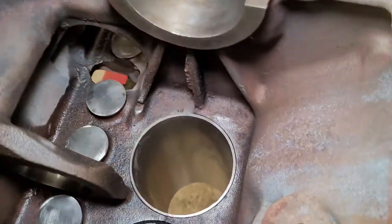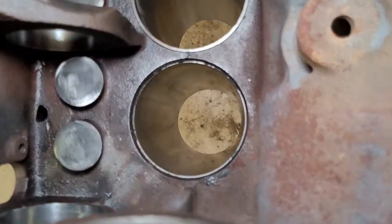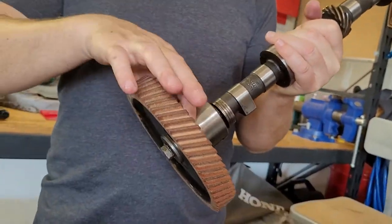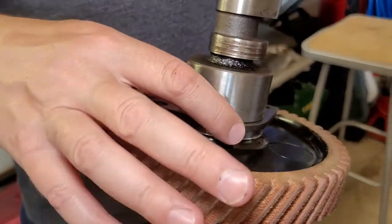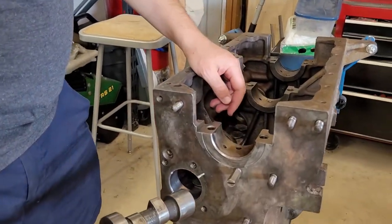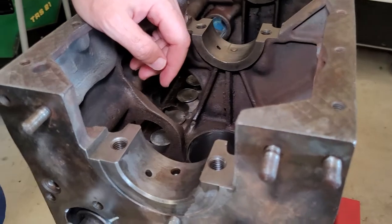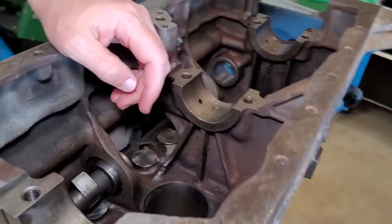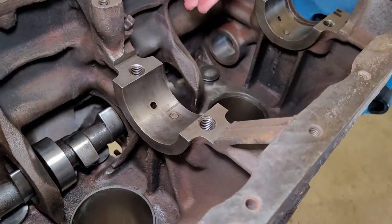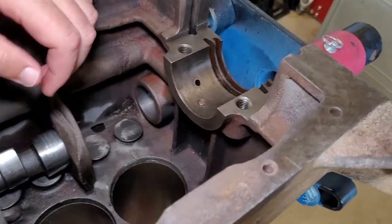You want to make sure that these have a little bit of lubrication on them — these already do because I've lubed these and the bores up that they ride in. You want to make sure that these are moving up and down without any binding. When you lift them up you want to hear that nice good thud when they hit the block, and as you can see with these, they do. It's important to put these in first because once the camshaft is in you cannot get them in. Then we go to our camshaft — I like to have the camshaft gear already installed.